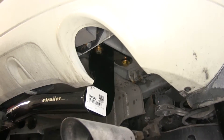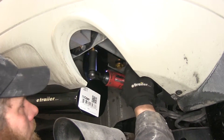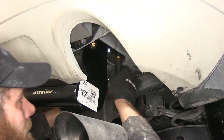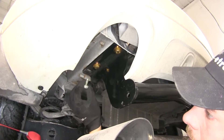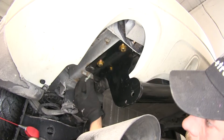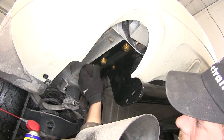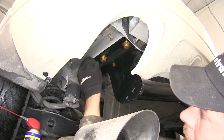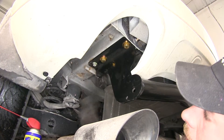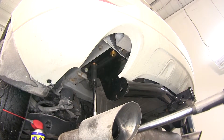Take a quick look to be sure you've got your hitch centered. Now we grab one of the four bolts from our tie-down bracket — that's going to get threaded back into the forward hole location. We'll look in our instructions, find our torque specs, and torque it down as well as our other bolts down to the appropriate specification.